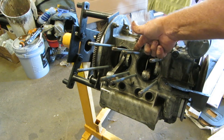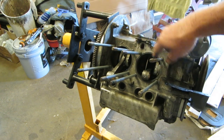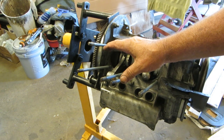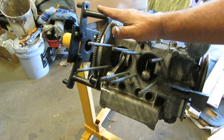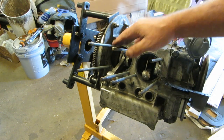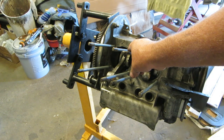And like I said earlier, in the first video I had on this, we did a pull on the studs on this case, and the case didn't make it. So I had them not put two in that. The two that were there, I had them do all of them. To thrust cut this case, to line bore this case, to put these studs in with a set of bearings, it was $205. So I thought that was very reasonable for everything to fit.